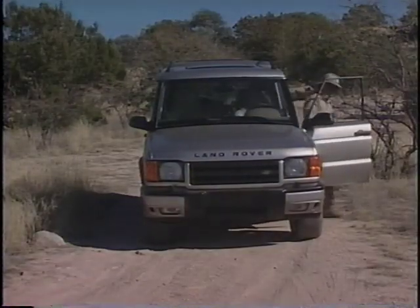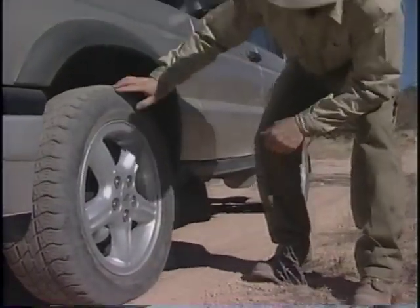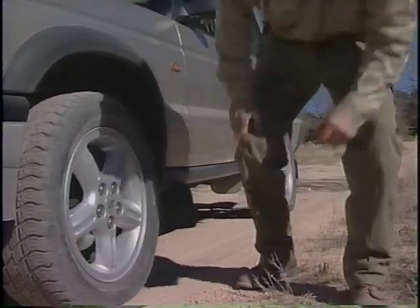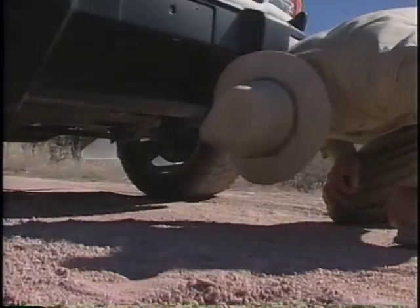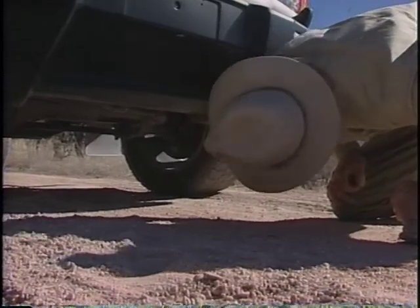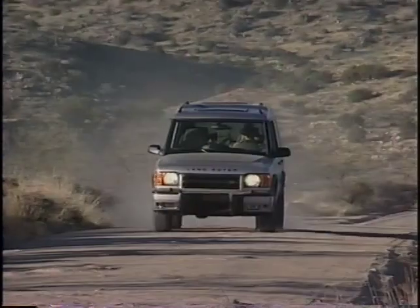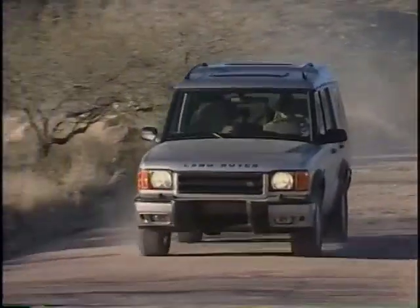It's very important to get out and make an inspection. Check the tires for damage, both inside and out. Inspect the inside of the wheels for debris that may be caught, along with the undercarriage as well. Remember to set the self-leveling suspension to standard ride height — it will automatically lower when the speed exceeds 18 miles per hour.